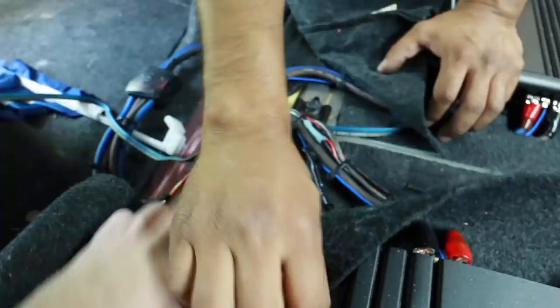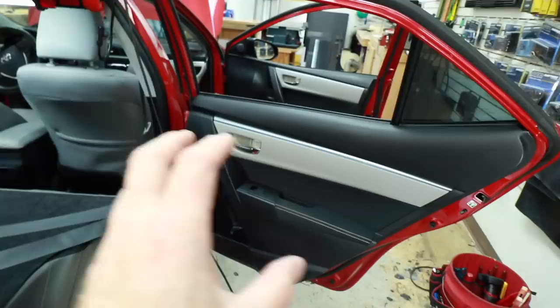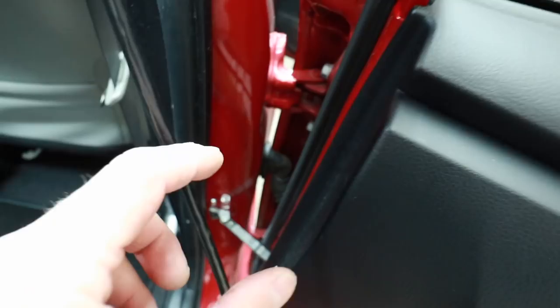All this is located right here at the hinge of the seat — this stuff has to move. Power wire isn't supposed to move. There's no place in your car, other than the boot, where that power wire moves. It's not made to move. Even in the boot, it is specifically designed that way. This is definitely not specifically designed to move.